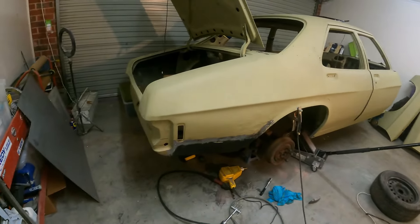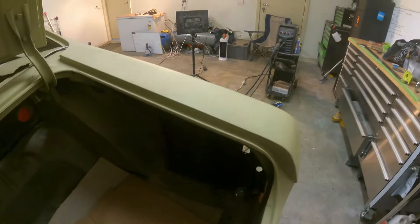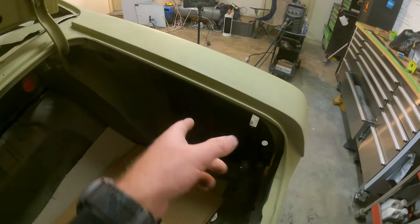To give you a bit of a recap — we've basically cut the lower quarter panel off, welded the section in from rear spares, and hammered and dollied a lot of the high spots from the welding. It's relatively flat through the panel now. I've been looking from the inside out with my phone flashlight, looking for light poking through. There are a couple of areas where I've missed with the MIG, so I've been highlighting them and going along and migging them up.